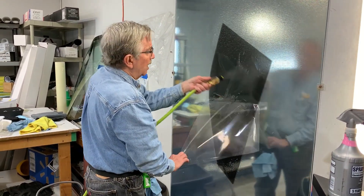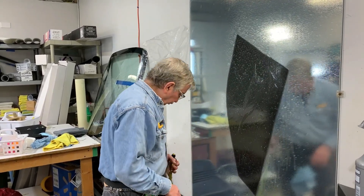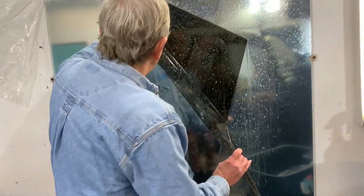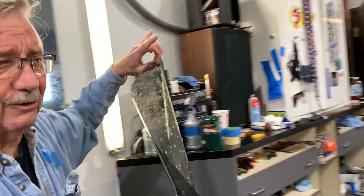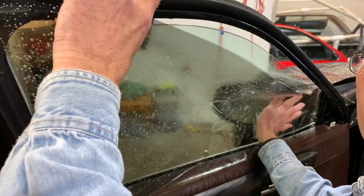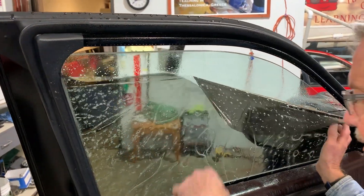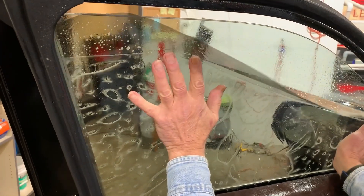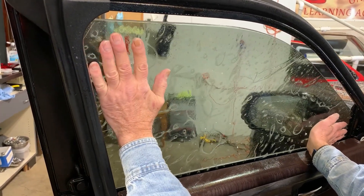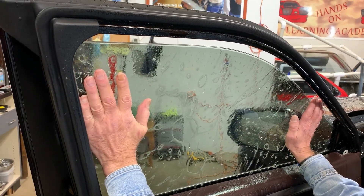Not going to have to shrink this window — not necessary because we're bottom loading. I pull the liner completely off. Be sure to throw those liners in the floorboard or your trash. Don't touch the film with your flat fingers — I keep a couple of long fingernails so I'm not getting skin particles on it. I put the bottom in first — hence bottom loading — and now I'm sliding it down carefully, and it's just about there.